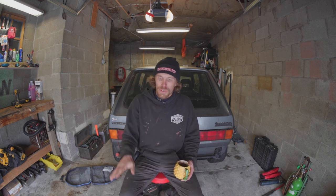My transmission specifically was doing a couple things in first gear. Going down a hill, selected in first gear — it should be holding there with engine braking, and instead it'd be kind of engine braking, kind of releasing, kind of engine braking, kind of releasing. It also had some pretty strange clunks with overdrive on and off, and on and off the gas. There were things with play that you could tell.